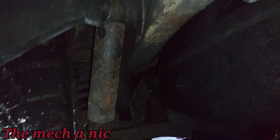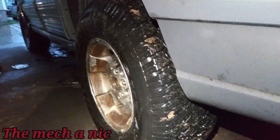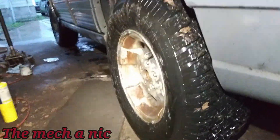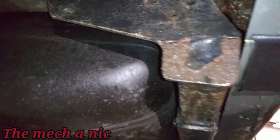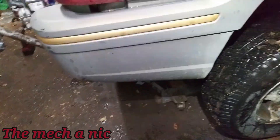I'm just a big old dummy — I completely forgot about the shocks that hold the rear end. I might be able to lift up the Jeep and let the rear end sag down, and that might give me some space to move it forward so I could get that bolt into the arm. Tried lifting the rear end from the tow hitch to get both wheels off the ground, but it's so rotted where it bolts to the body that it was loose when I touched it, and the higher I raised the car it felt like it was just going to push through the rail. So I'm going to let the Jeep back down and do it from the sides using jack stands.